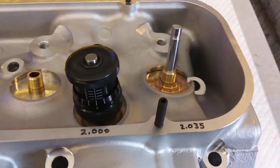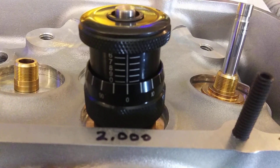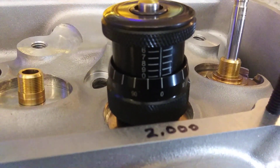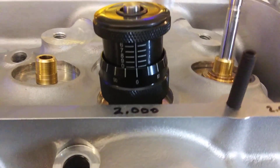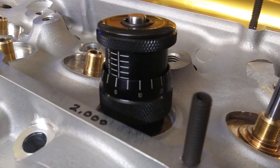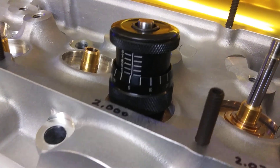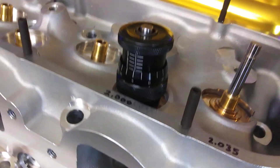I'll be figuring out what your installed height needs to be. See, it's 0 and 0. So if it would've stopped at the .50 there, it would be 1.950. And if it would've stopped on the .010 there, it would've been 2.010. But with this particular combination — a .100 long valve, a .060 thick locator, and a standard install height lock — it comes up to 2 inch. So a .060 shim, and that's golden.